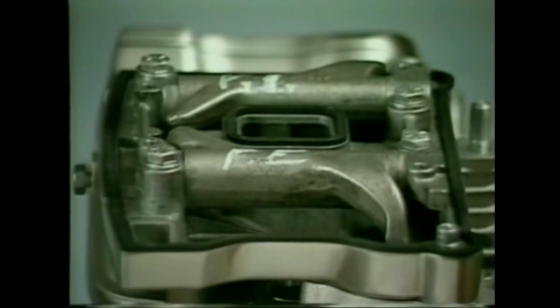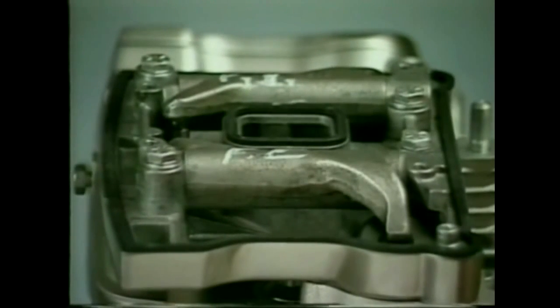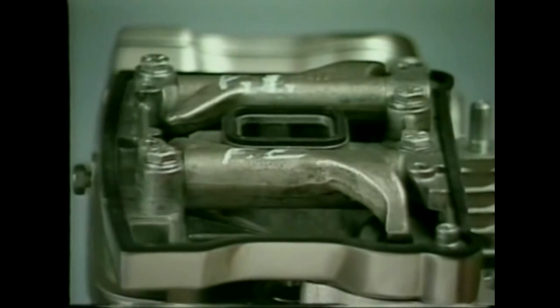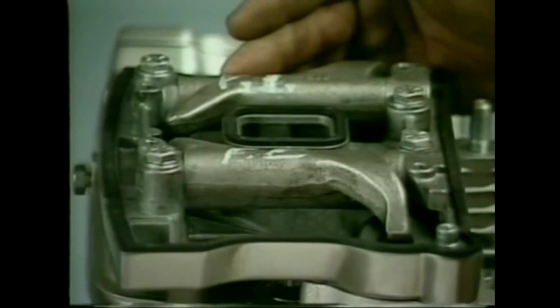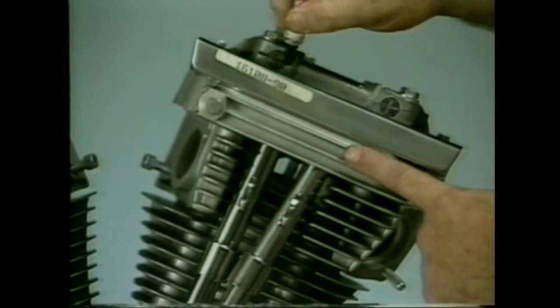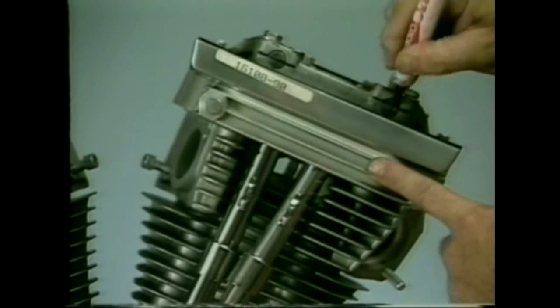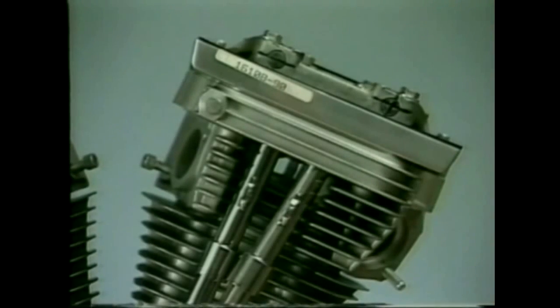You'll notice that the front inlet rocker is the last to rise and finally fall — this is true of all four-stroke engines. We need to mark each rocker arm and shaft so that when it comes to reassembly, we'll be able to replace each set correctly. We mark one rocker arm front inlet or FI, and the other front exhaust or FE. Across the inlet shaft we draw a horizontal line, and for the exhaust a plus or cross, making sure the marks go across each rod and onto their corresponding journals.